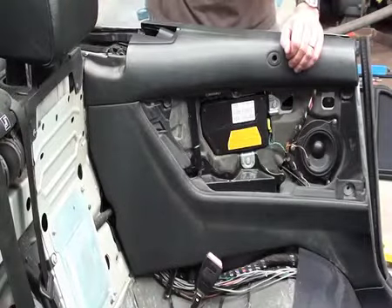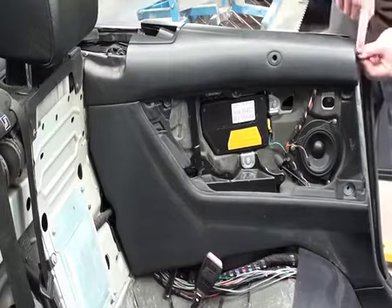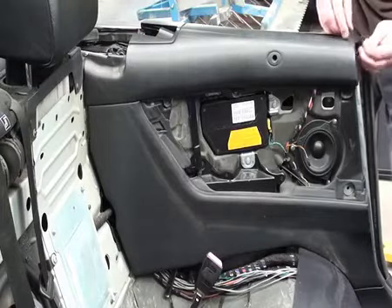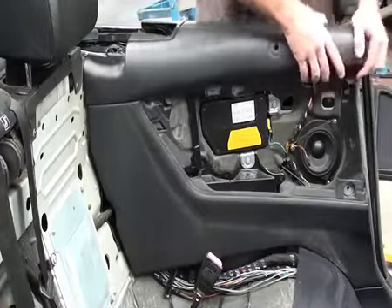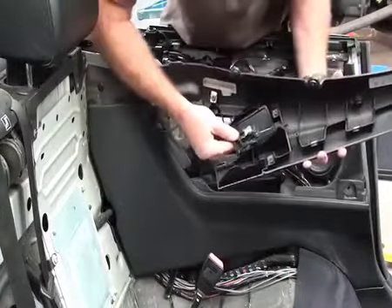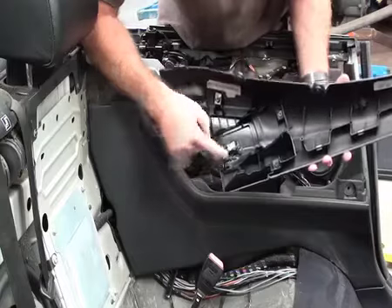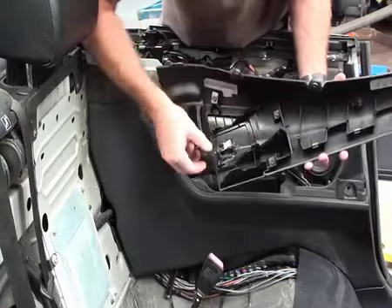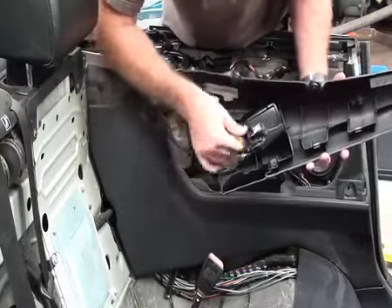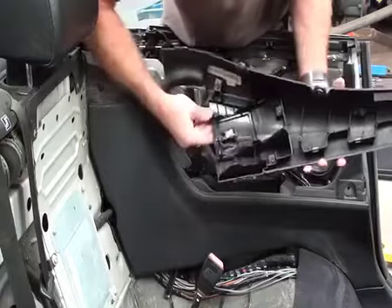I'm going to remove that rear seal. I'm also going to come up the front here — there's a little knob thing there — you need to feed that over so it's clear of that. Now I can just gently pull that up and that whole thing will unclip off. One of the things that does break on these is this sliding mechanism, so the first thing when they talk about this in the TIS with servicing is they occasionally put some lubricant on these rails here so they can slide nice and easily, because that spring is going to be pulling that back and forth as the roof opens and closes.